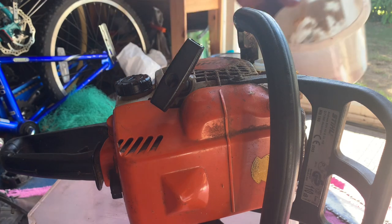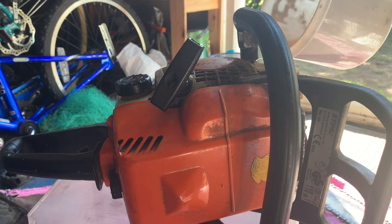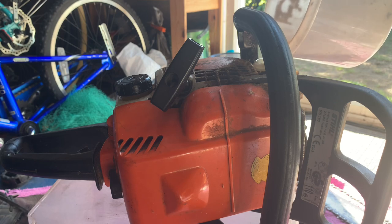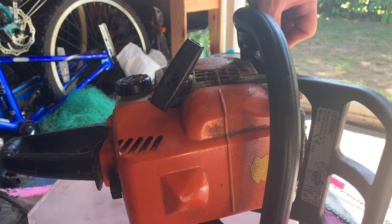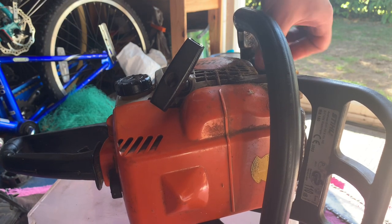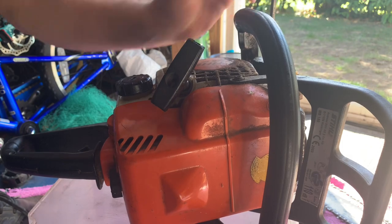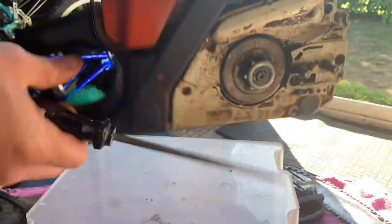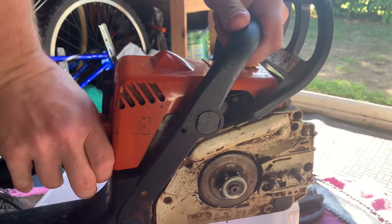Next up I've got to pour the oil back in. Make sure you've got enough in there to cover the filter, slide that in, and then I should have enough now to start it up.